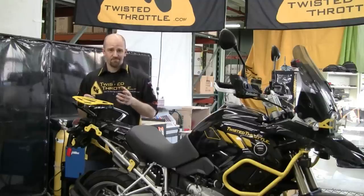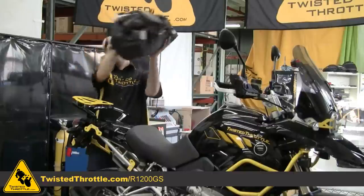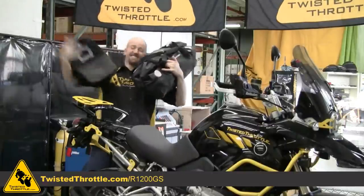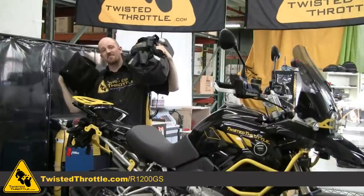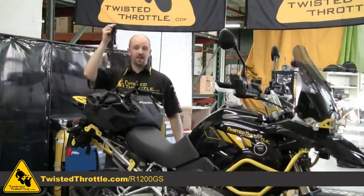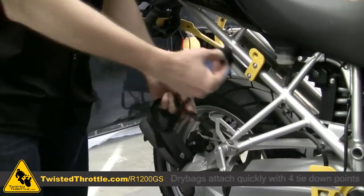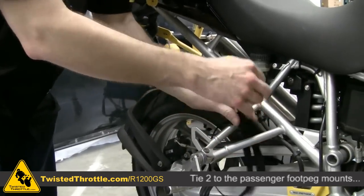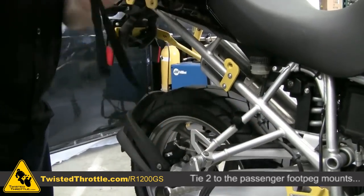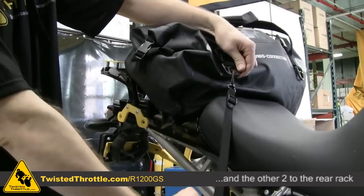You may want to throw some soft luggage onto the rear of the bike — it goes on the back seat. It attaches to the motorcycle with straps. It comes with four straps: a little loop at one end and a clip at the other. You put the loop through any closed loop on your bike, pass the clip through the loop on the strap, attach the D-ring, and tighten down.